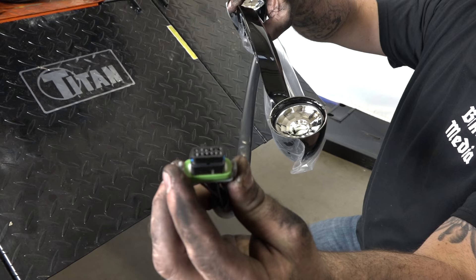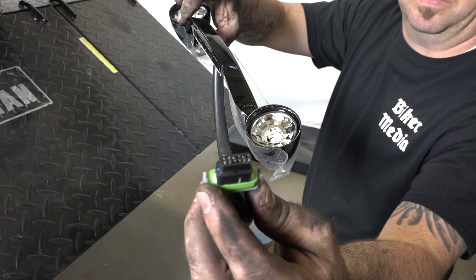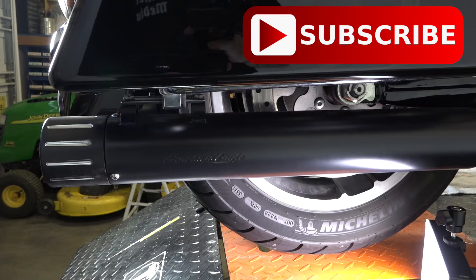The next process — this is the actual new turn signals, but we're looking at that plug. That's just like the stock OEM one of course. We're going to get up underneath and show you where that is. It's got two clips on the side of it; you kind of have to pry them out with a screwdriver to get that plug to release. We're going to go up underneath the bike and work on getting that undone.